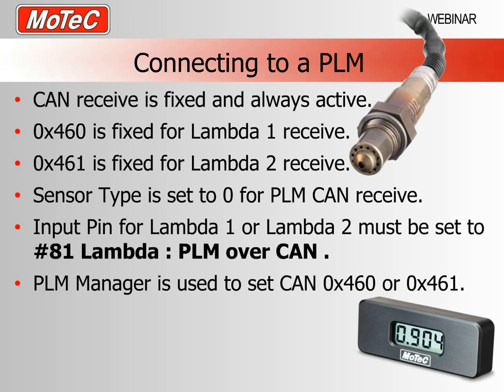The Lambda devices that may come in handy with M84s — the M84 is sold with one Lambda channel enabled, allowing you to connect directly to a wide band Lambda probe or a narrow band Lambda probe such as the NTK Lambda or Bosch LSU sensors like the LSU 4.9. If you need more Lambda, the options are: purchase an upgrade code to enable the second Lambda wired directly into the ECU, or use a separate Lambda controller that produces CAN information which you then receive into the M84.